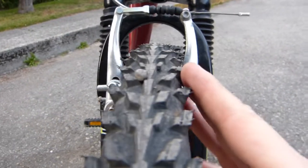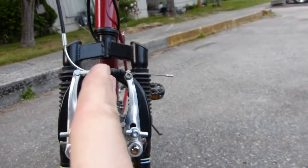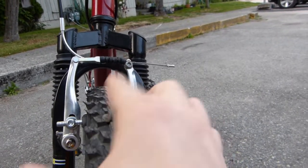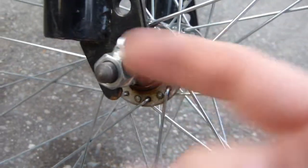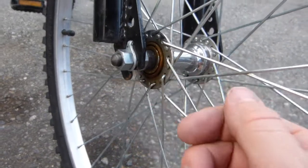and the wheel needed just a little bit of truing with a spoke wrench here, just a few of them, to make it fairly true so that it passes easily between the brake pads. No issues. The wheel was of course mounted in a way that it's centered in the frame. It's correctly mounted with these tabs in the hole, like I said, and of course the cone was adjusted. It needed half a quarter turn.